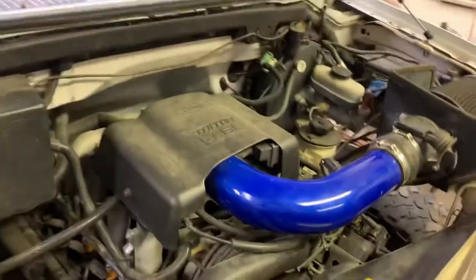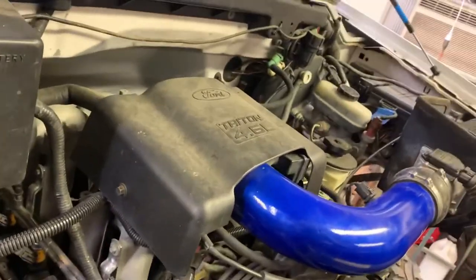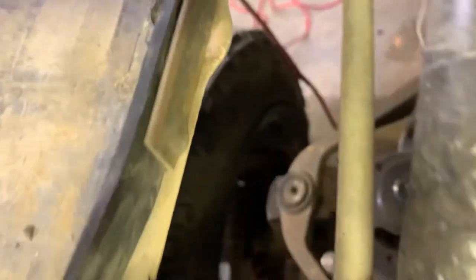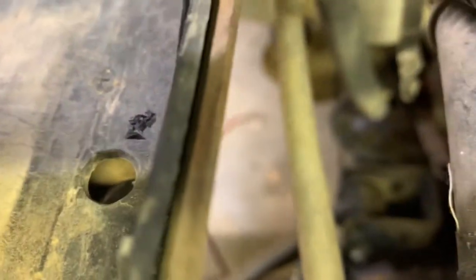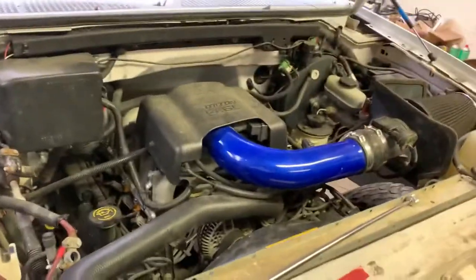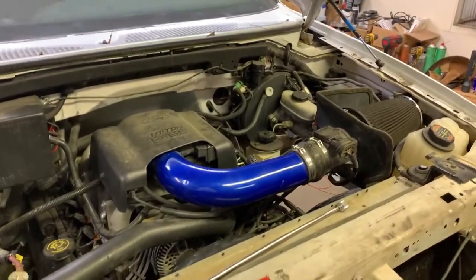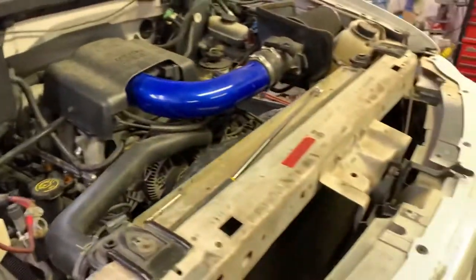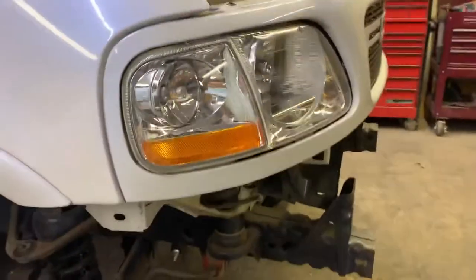This is for the body lift video. I was working on cleaning up the wiring — those are the tubes for the hood washers. Got this stuff hooked back up where it's supposed to be, and got one ground down there on the frame hooked back up. My grandpa's down there working on getting the body straps back up. We've got to drill a hole in the cab mount down here for the ground wire, and then we should be done with all the grounds.